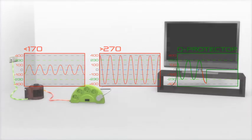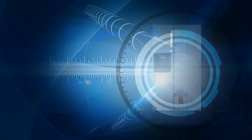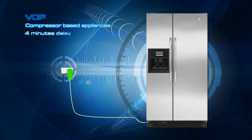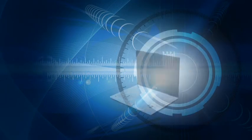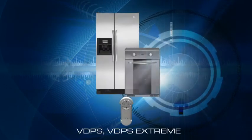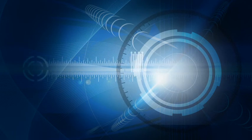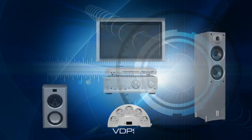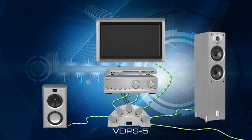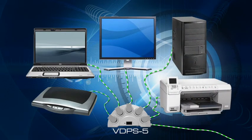The Q Protector turns the appliances back on only after validating the power supply level and stability. In appliances with a compressor, after 4 minutes delay. In appliances without a compressor, after 10 seconds delay. Use VDP or VDPS with single outlet to protect a single appliance, like washing machine, oven, refrigerator, and others. Use VDPS5 to protect a group of appliances, like home theater or a computer with its supplementary equipment.